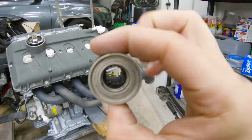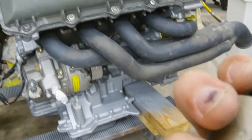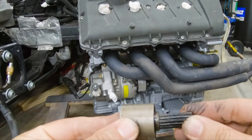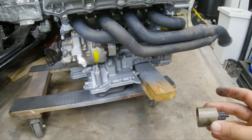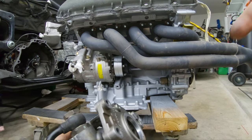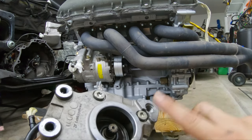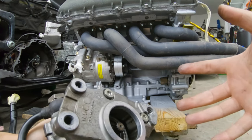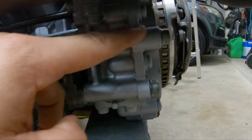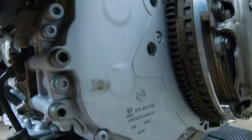The power steering pump connects to the engine block with two screws — a shorter one and a longer one. There's also a gear/teeth piece that pairs up here. There's a little gear detail that faces toward the engine/timing side. There are actually three bolts total that hold the power steering pump on — the two I just mentioned and a third one that gets attached when the transmission goes back on the engine. So don't worry about that third one for now. Power steering pump is on — top bolt is the long one, bottom is the shorter one.